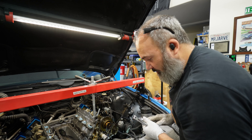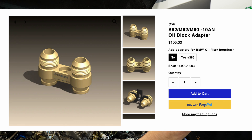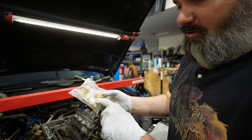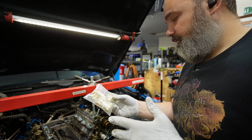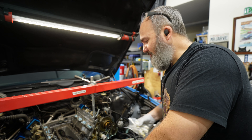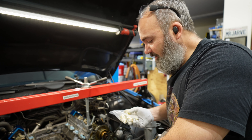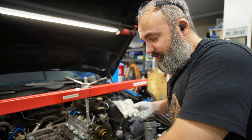If you happen to be doing any type of performance build on this engine, take a look at Speed Haven's website. They have an AN adapter — I actually have one for the M5 that hasn't been installed yet. You've got your adapters at your oil filter housing and then your AN adapter down at the block, which allows you to run an inline cooler. This engine doesn't have a cooler; the M5 has a coolant-driven cooler in the valley which is not great. Either way, if you're looking for performance mods — not sponsored, nothing like that — the guy just makes fantastic products.